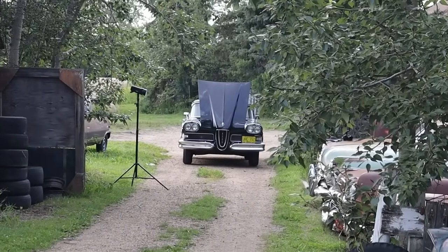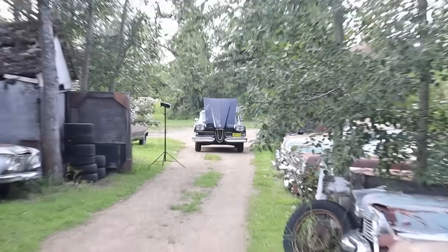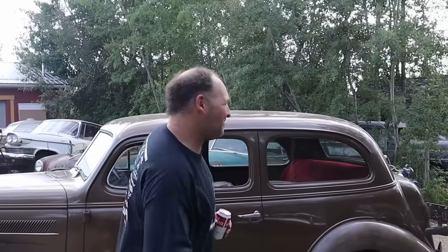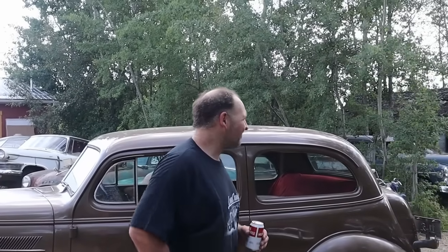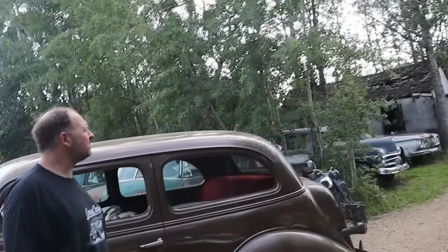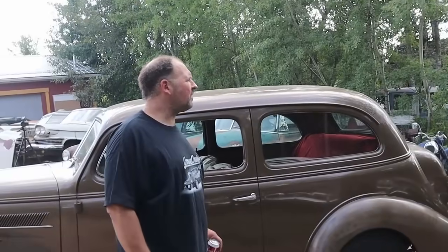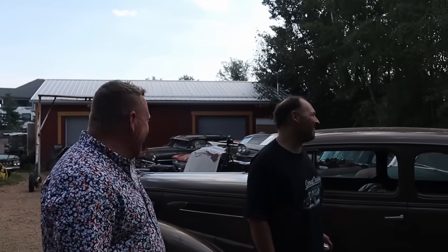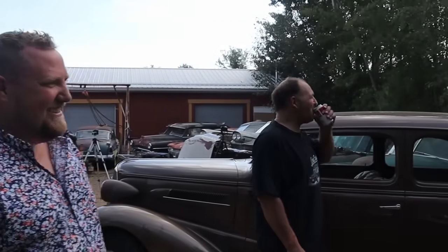Yeah, I had to come here looking like I knew something about cars for a second. So I see what's going on here. You didn't just take the relay apart and sand the points, eh? That's what has to be done. Today the horn just stopped working. And then you heard it a little bit there, like the honk? Yeah, I heard it working fine when you got here. Just a bad ground. No, it's just the points in the relay. The tire's flat, it's a bad ground. The car's on fire, bad ground. Oh, I crashed into that guy, bad ground.